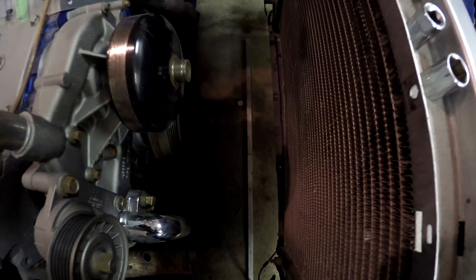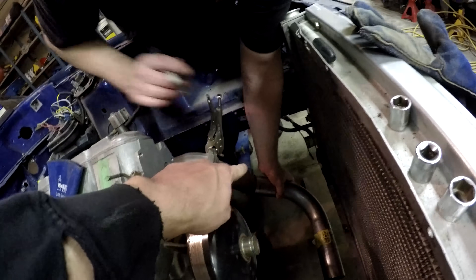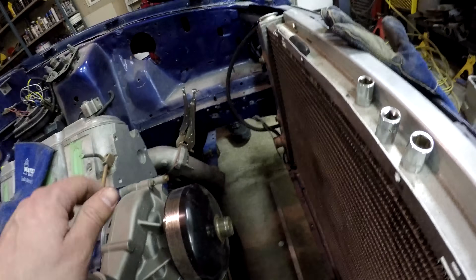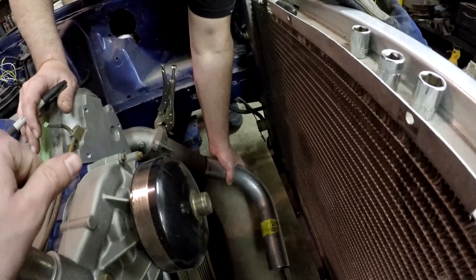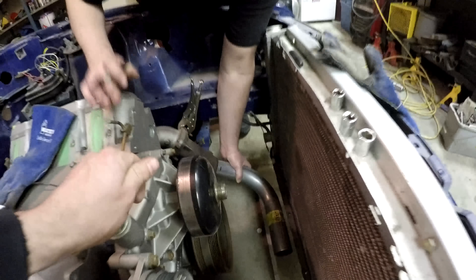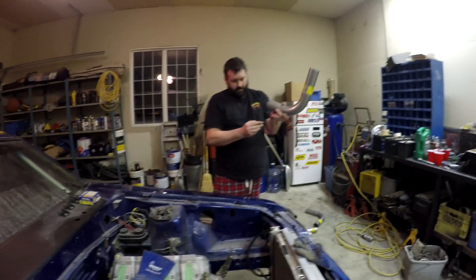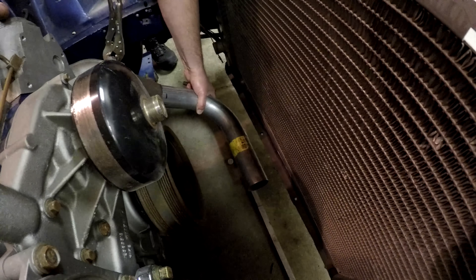How it is right now it's too low. I don't want to be able to see it below the core support — I think that's a safe rule of thumb for hot side height. So what we're going to do is take a bit off the top of the angle so it twists up, and then we'll just have to shorten it a bit to bring it away from the radiator. You also have to keep your electric fans, shroud, and whatever type of fans you're using in mind, but if it's about that far away it shouldn't be a problem.